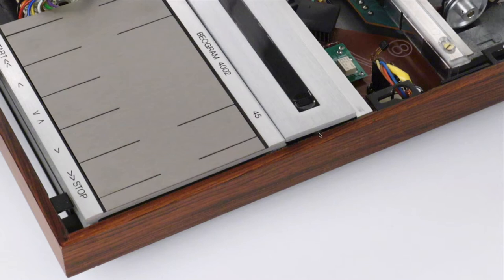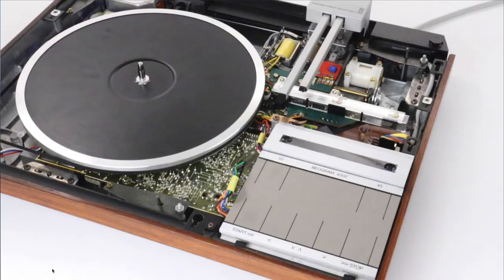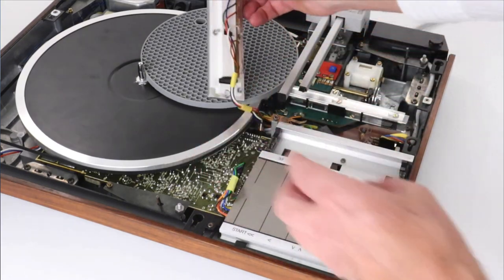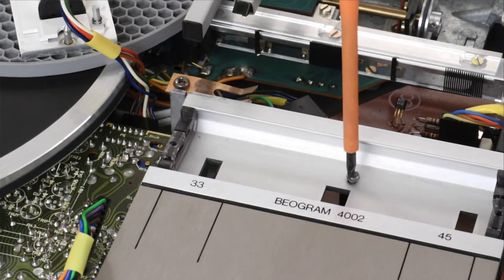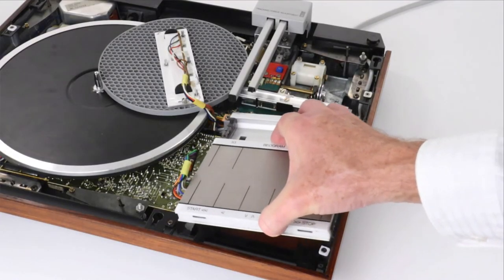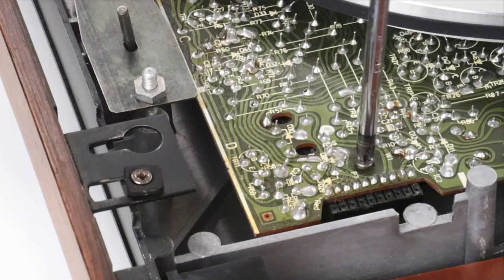My plexiglass part is already a little worn out, which is why the panel isn't entirely down at this point. With the panel loose, we can extract it — I like to use one of my wife's trivets to protect the surface. It is best to take out the keypad cluster for plugging in the commander board, so remove the screw that holds the keypad down. Now you can lift out the keypad. The final disassembly step is to take out the screw that holds the PCB down.